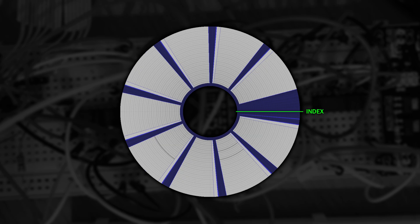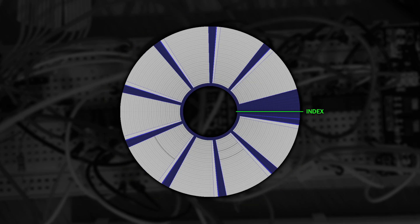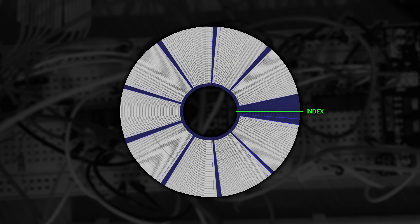By timing how long it's been since the rotation started, the position of each sector could be roughly located. Now because each drive spins at a slightly different speed, and you might be reading a disk that was also written at a slightly different speed, a certain amount of tolerance was needed to help locate the sectors. And that's what these gaps are for, as well as allowing a small amount of space in case your drive spun a little bit faster and took less time to write the same amount of data. This gave it space to expand into without damaging the next sector, and has the advantage that only a single sector needs to be written if it changes, which also might make it faster.